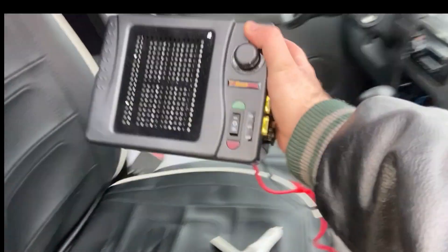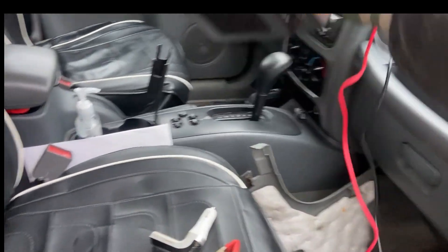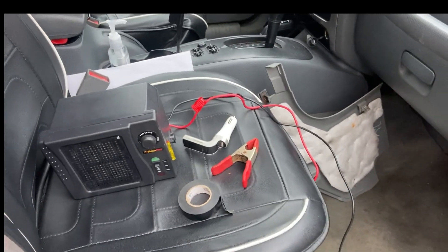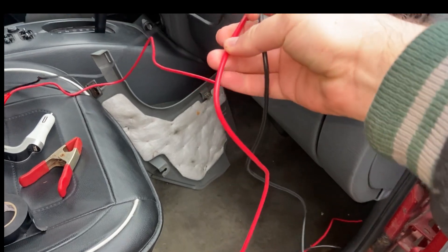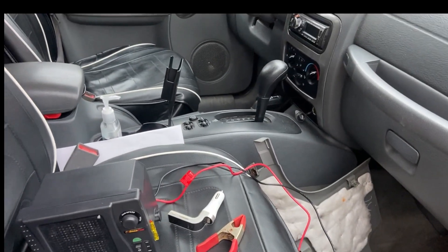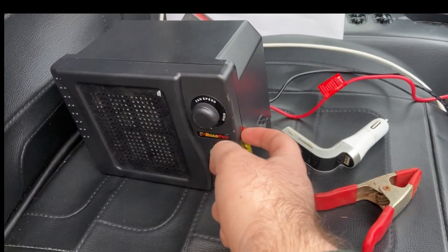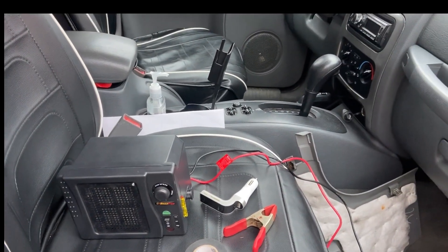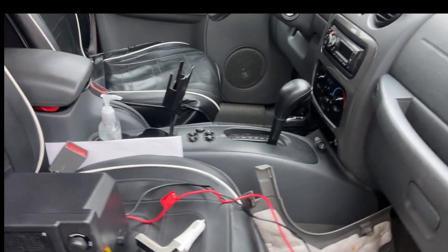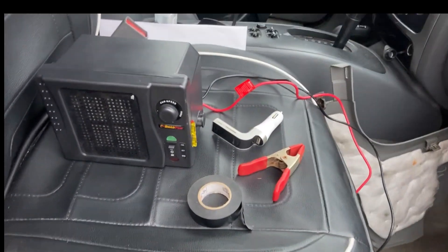I'm going to be installing this electric heater in the car — I just have it loose with the wires for now. It'll just live inside the car, and I have a 30-amp breaker that I'm going to be running this heater off of. I'll put that in line somewhere on the positive lead inside the car. Once it's energized from the battery, there's a status light that's always on, so that'll very slowly drain the battery — I don't want that. So that breaker will double as a switch; when I'm not using the heater, I just trip the breaker and that cuts power.